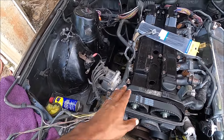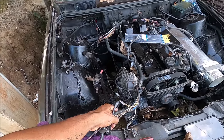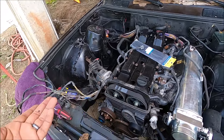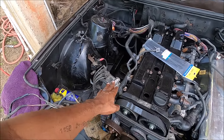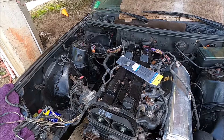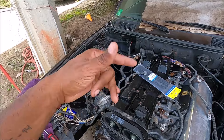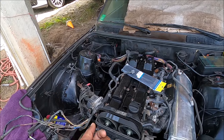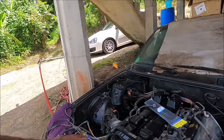The harness is already routed and I've already begun stripping it out. It has a few extra plugs I don't need, so my plan is to remove the unnecessary stuff and only leave what you need to run the engine: injectors, single coil distributor for RPM signal, TPS, IAT sensor, coolant temp sensor - that's about all you really need. I'm also going to add a boost controller and use the factory knock sensor to see how well that works. I've heard it doesn't work best with 2JZs - I generally always use Bosch wideband knock sensors - but these are on there so I'll test it out.